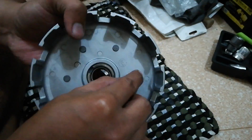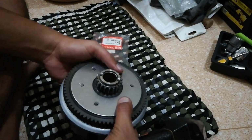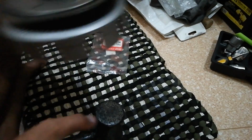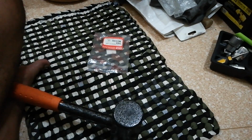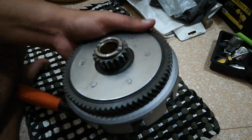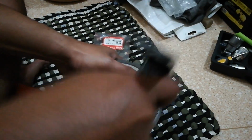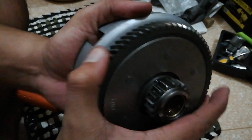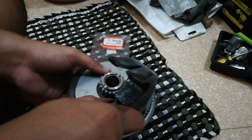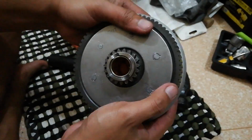After installing a couple of rivets, we can then go ahead and remove the two marker rivets that we have inserted to this side. We then install them like the other ones by doing the same process. After all the rivets are installed, you need to run through the rivet heads and hammer them again a couple of times to make sure that all heads are thoroughly flattened and are locking the whole clutch basket set properly. After doing this, it would not really hurt to wash or air compress the whole clutch basket again before reinstalling.